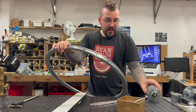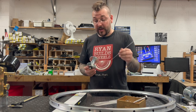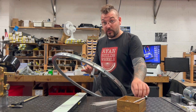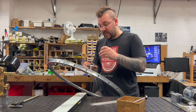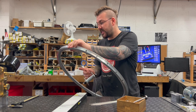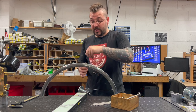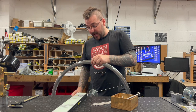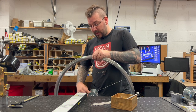Lacing is a simple exercise — really all it is is getting your spokes into the hub so you can attach them to the rim via your nipples. I'm going to be lacing this wheel in a two-cross tangent pattern. We could have it laced radially — radial means the spokes go straight out from the hub at a 90-degree angle, taking the quickest path to the rim, saving a little weight and making it a little stiffer in the lateral, side-to-side plane. However for this build, thanks to the aesthetics we wanted to achieve, we've gone for a tangent pattern. At the moment I'm lacing entirely by hand because I haven't crossed any of the spokes as yet, so I don't need to use the nipple assembly tool.